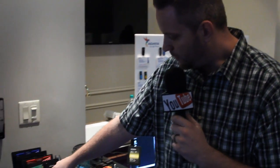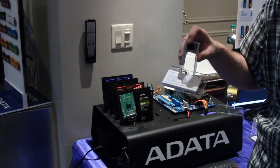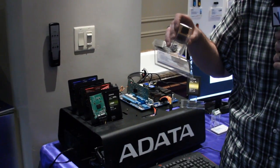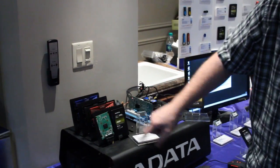It's 16 by 20 millimeters in size. To give you a perspective of what this does to the overall size of the SSD, they've got an SX900 right here basically ripped open, where they have just one of those chips in the middle. This little chip right here is actually 128 gigabytes. So if you were to get an array of these inside of an SSD, it allows you to make a very large capacity SSD in a very small form factor.